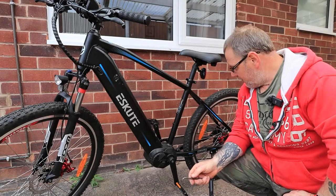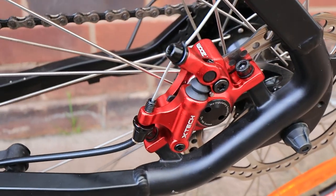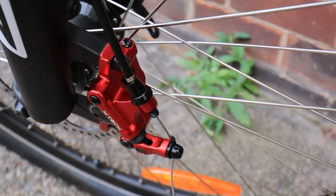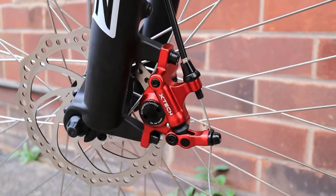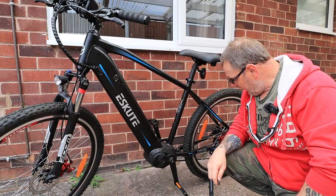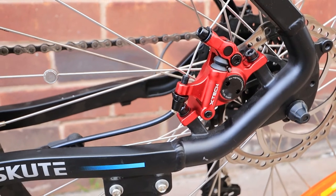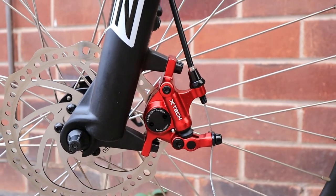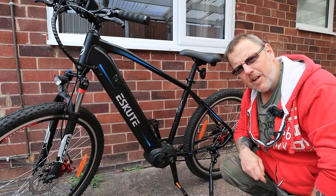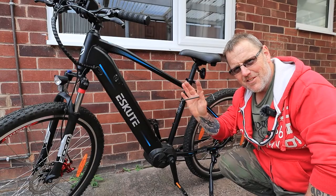So that's the installation instructions — the best I can give you. Just make sure you've got a 5mm allen key, you've got two nuts with locking threads to go on, and make sure they're tight. Any adjustment you can do with the screw. Just pull the clamp back, lock them up, nip them up tight, and that's it — installation done. Any questions, if you want to know anything else let me know. I think they look really nice — let's hope they work as well. Cheers, ciao for now, bye bye.